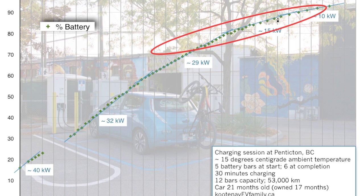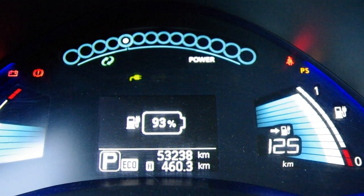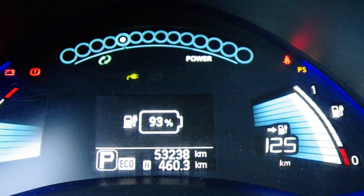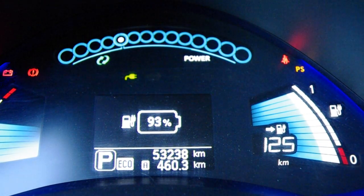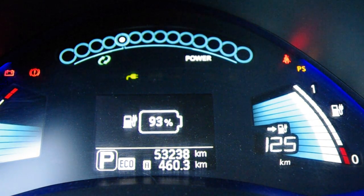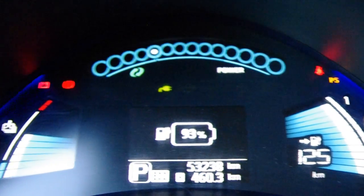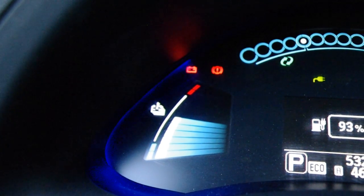The best fit shows it was approximately 15 kilowatts in that range, slowing down to about 10 kilowatts. The charger just kicked off automatically — the charger talks to the battery and sorts out when it's best to stop. It stopped at 93%. Normally it would stop lower than that, but my battery has degraded somewhat, so 93% for me is kind of like high 80s for somebody with a brand new car. As I thought, we picked up one battery bar, so we're now at six battery bars.